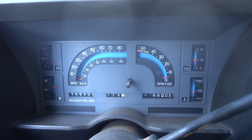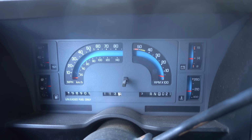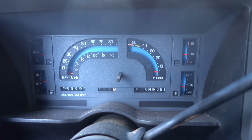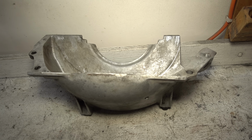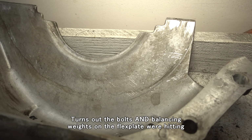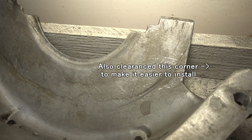I noticed a bit of a strange sound when the engine was running, like a tapping, and I realized the heads on the torque converter bolts I used were a little long and were hitting the inspection plate. All I did was put washers in between the inspection cover and the transmission, and everything worked out.